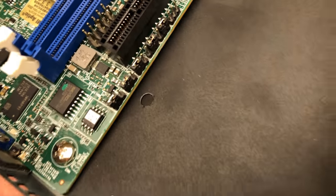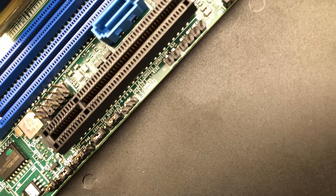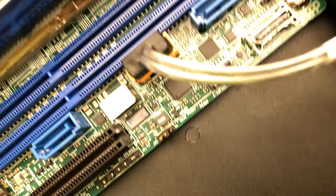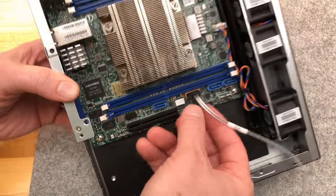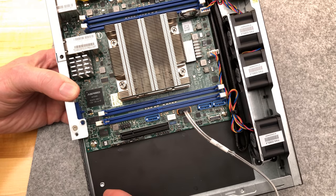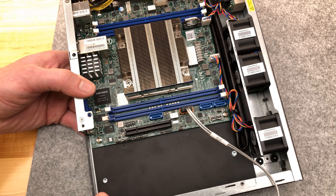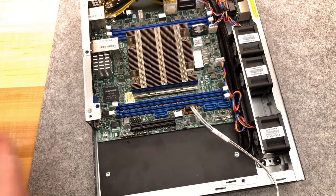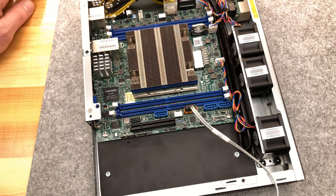There are a lot of jumpers. I'm going to turn autofocus back on so you can see everything going on on the motherboard as I slide the camera across. Cross-referencing things in the structure manual should tell us exactly what all those hardware jumpers do. For a count of SATA — one, two, three. Yellow is for SATA DOM. If you're not familiar with Disc on Module, SATA DOM is a good place to install ESXi with more resilience.